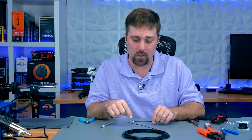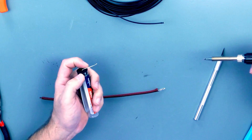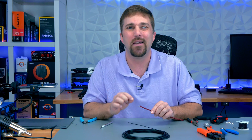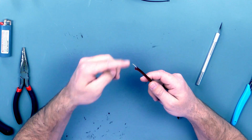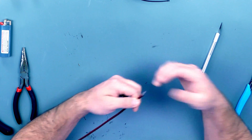Finally, because that first set of wings don't have those tiny strands to grab onto, this pin does have a greater potential to come off if you're not careful. So there are two ways to fix this. The first is you can just use a tiny bit of solder and solder the pin on. Or what I typically do is basically fuse it with the heat shrink method of attaching the sleeving, which involves heating it longer than I typically would and melting it a bit further down. So in this case I'm not just using the heat shrink to melt the sleeving under it, but I'm also starting to melt the insulation under the sleeving and fusing the pin to that insulation, and then the sleeving becomes like a hard plastic shell fusing it all together.